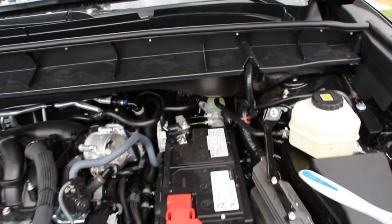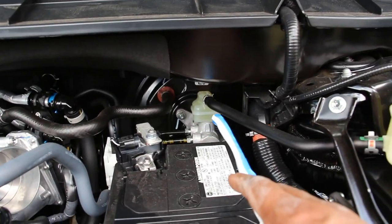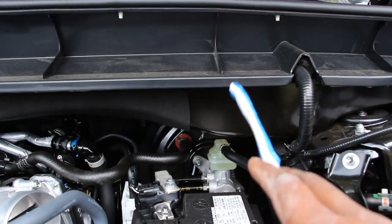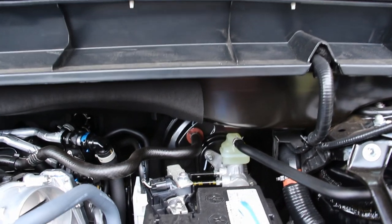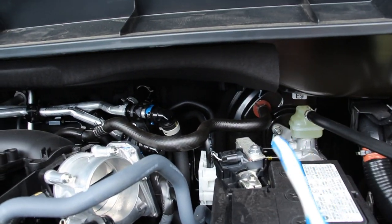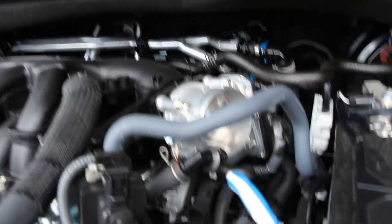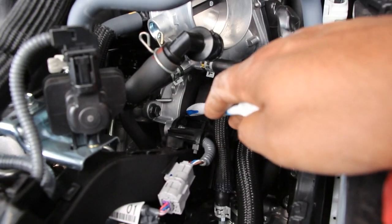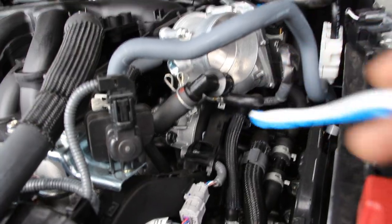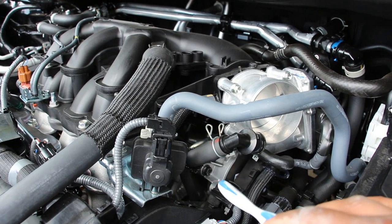Next we'll take a look at the braking system on the Highlander. We'll start over here where you have your master cylinder — it's got a small tank on it which feeds off of this much larger tank, because it's a little difficult to access underneath this windshield cowl here. In and behind there you have a brake booster that's vacuum powered, but if you follow that line it actually does not lead up to your air intake plenum — it's fed off of this vacuum pump located down inside of here, which is actually driven off of the intake camshaft on the rear bank.